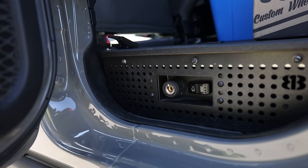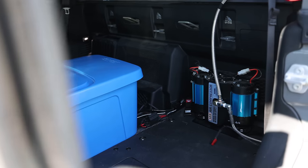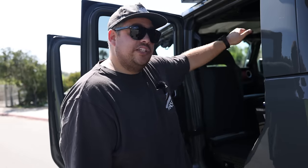We've got an 813 Fabrications compressor mount, so the air chuck is right here and the switch for the compressor is right here. We've also got OWL — sponsored by Wifey — you can find him on Instagram. He's known for a system called the Wifey air system, which allows you to air up all four tires at once and air down all four tires at once. You go to each wheel well, plug the chuck in, hit one button, and all four will go up — they equalize from a pressure standpoint. Airing down works the same way. We were able to fit that behind the National Luna 50-liter fridge on the 40% seat delete.